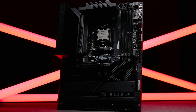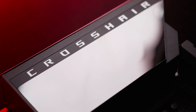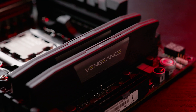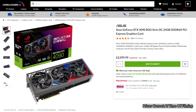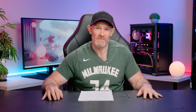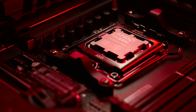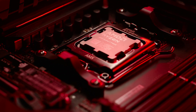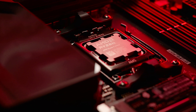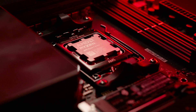The test system I used: the motherboard was an ASUS X670E Hero on the latest BIOS with the latest AGESA code. The memory was a 5600MHz Corsair kit with CAS latency 36. The GPU was my standard RTX 4090, a ROG Strix, and the cooler was a 360mm AIO by EK. My OS was on a Western Digital SN850X, running Windows 11 with the latest chipset drivers, latest GPU drivers, and everything updated to get as much as possible out of the CPU.